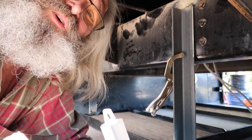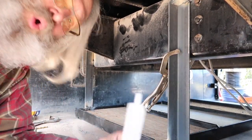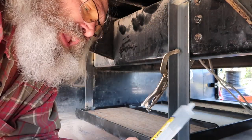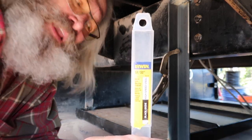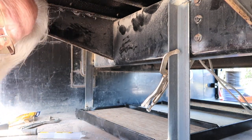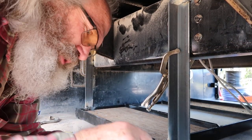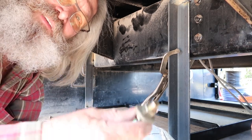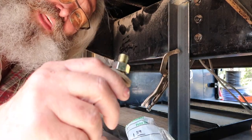I'm going to be drilling the holes to mount this rack for the batteries. I'm using a quarter-inch drill bit first, just as a pilot hole, and then I'm going to be using this 17/32nd bit. It will be a little bit bigger — a little bit of room — because what I'm putting in is a full half-inch bolt.